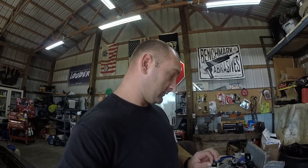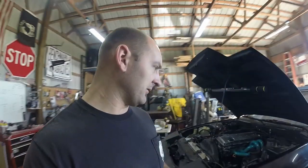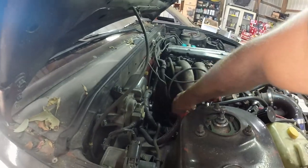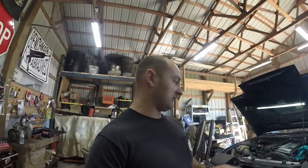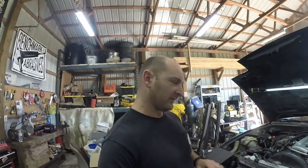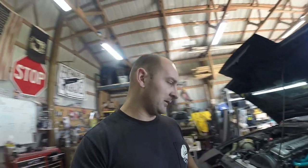The fuel pump just needs to be slapped in there - it's already low on fuel, so this is a perfect time to throw in a fuel pump. There's one other thing: my water line to the turbo. I figured it out - I have a looped coolant line on the back because I don't have a heater core anymore. Instead of just looping it at the back of the engine, I'm going to loop it through the turbo instead, which will provide the water I need for cooling the turbo.